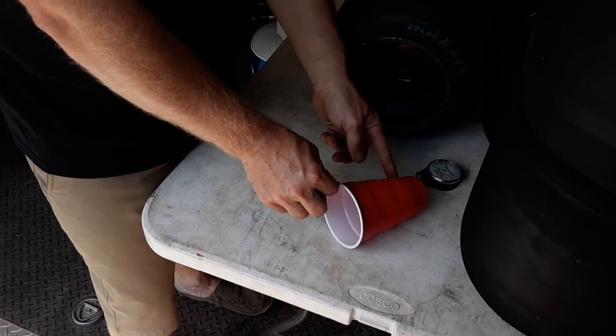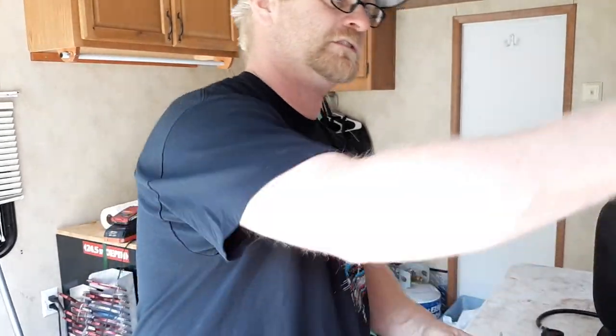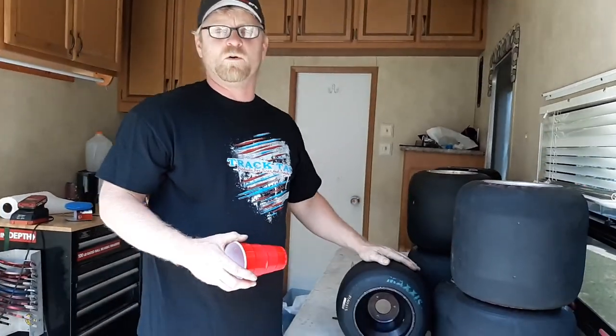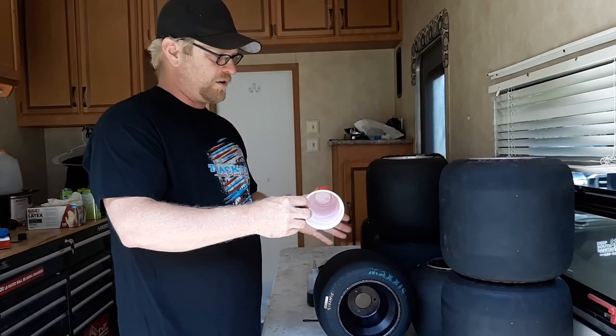That's why you'll see drivers try to arc the straightaway as much as possible coming out of the corner — they're literally trying to make a big circle. If the track were a perfect circle you could set your stagger and just hold the wheel steady. On long straightaways, you want to pull a little stagger out so it's not constantly trying to turn you into the center of the track. But there are other factors too: front cross weight, left-side and right-side weight, and how much the tires grip through corners and down straights. Find one factor, master it, and work it into your setup at home and at the track.